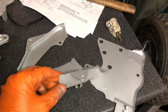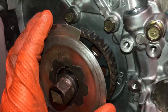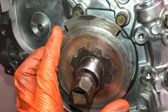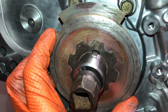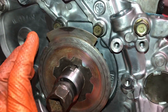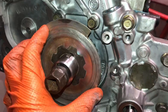I went over a few of the covers and zinc galvanized coated them — they look much prettier now. When I started to put the bottom pulley back on, you can see I put the balancer shaft pulley on the back, and this is the timing disc for the crank sensor. If you look, it's obviously worn away on either side — it's been moving about over time. It should sit exactly at the notch at the top, but you can see how much play is in it. This is going to cause — or probably did cause — running issues, and especially when mapping you're not going to be able to get cam sync or top dead centre of the crank sensor properly. That's got to be replaced.